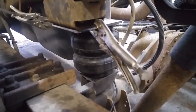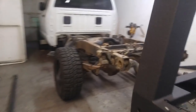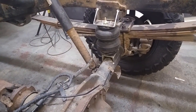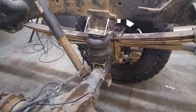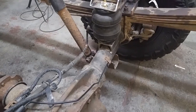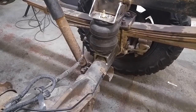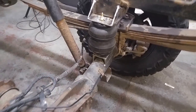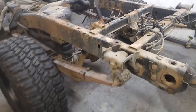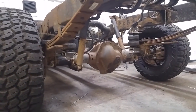I finished up those airbags yesterday - just made some nice simple brackets out of quarter inch steel, welded them all to the frame so they're not going anywhere. On the bottom I used channel because you still need to be able to get under there - there's a bolt under there so you still need access into the bottom of the airbags. It turned out pretty good. I'll just run the airline to the back after when I get the deck on. For now I was just testing them - that's why there's an airline on the top.